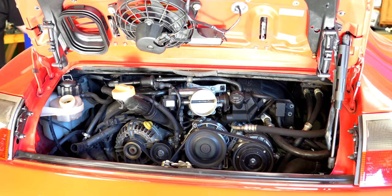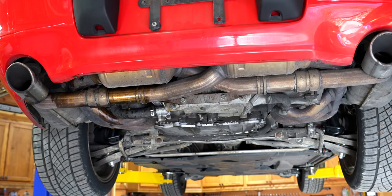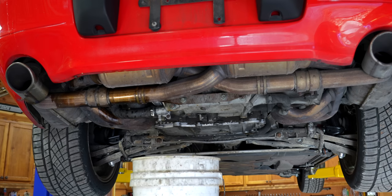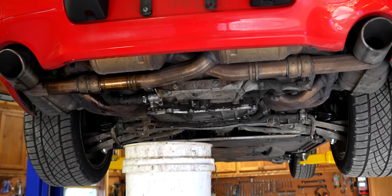There's no drips - let's just let it run for a little while and re-drain it. So it's run for about 35 minutes on the lift. I was watching it go from like 195, then the thermostat kicks in like 180-185, right in there. The thought just crossed my mind - we should probably put the radiator cap on and then the fans turn around like they should. I was going to pick up the radiator cap, but it threw coolant all over my floor. Mild inconvenience.